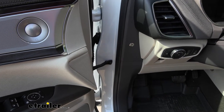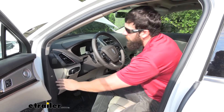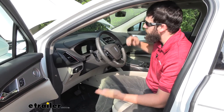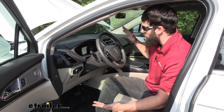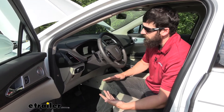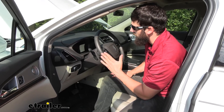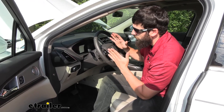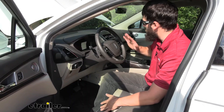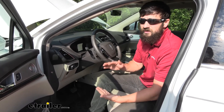To demonstrate, I'm simply going to hit the engine start button — not going to start it, just going to turn on all the lights. We should see some of our interior lights come on as well as the dash light up, so we know the vehicle is on and the battery is connected. In order to test out the battery disconnect to show you that it's working, all we need to do is hit that switch. We should hear a pretty loud audible click from the solenoid letting us know that power has been disconnected, and all the lights on our dash and interior should shut off. You can see we hear the audible click and everything is shut off — this is what we need to do before we tow our vehicle to make sure the battery is disconnected and we can safely head down the road.